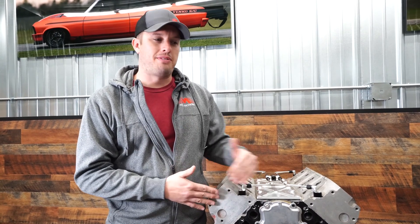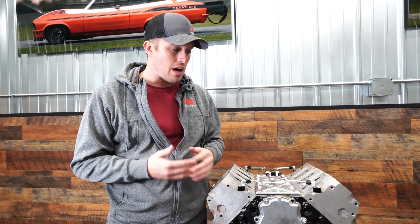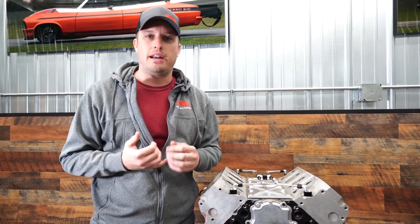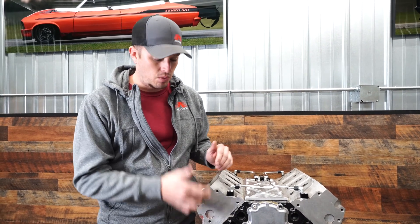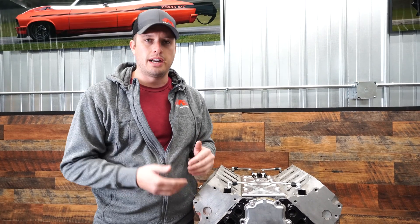Let's break into some facts. Aftermarket LS heads do not have these, so one of the conversations I see is people saying, 'Well, if you're pushing those out you have other problems.' Not necessarily — factory heads do have them and aftermarket heads don't. The reason they can be an issue is the heat of the cylinder head. Anytime you add nitrous or boost you're creating conditions it wasn't designed for originally, and with two dissimilar metals — an aluminum head and a steel plug — you have an opportunity for things to heat up, distort, and come right out.